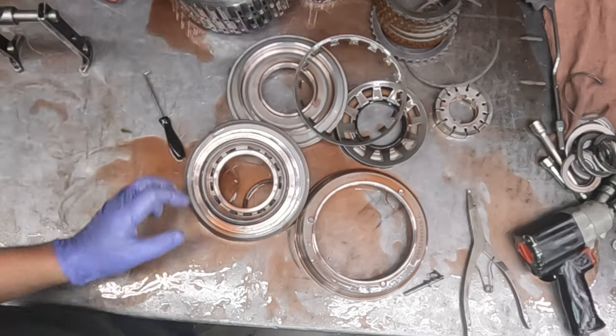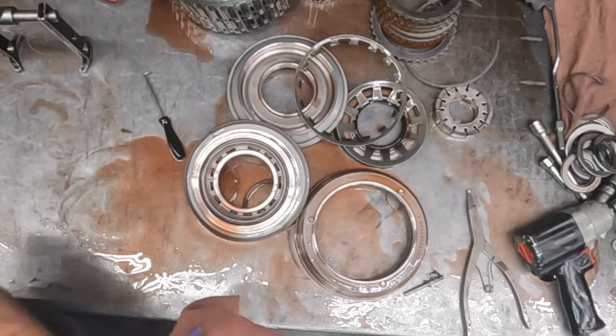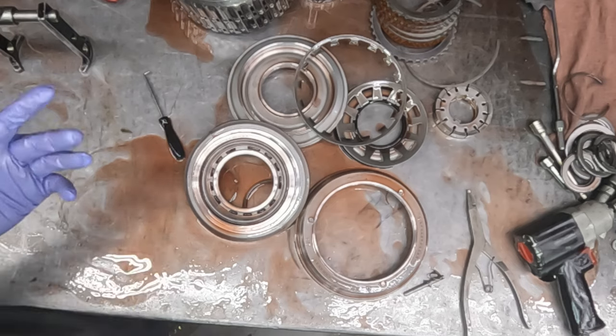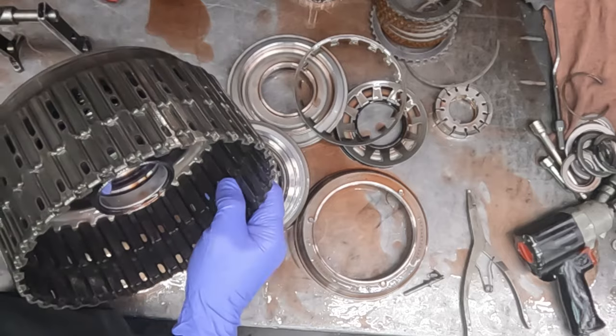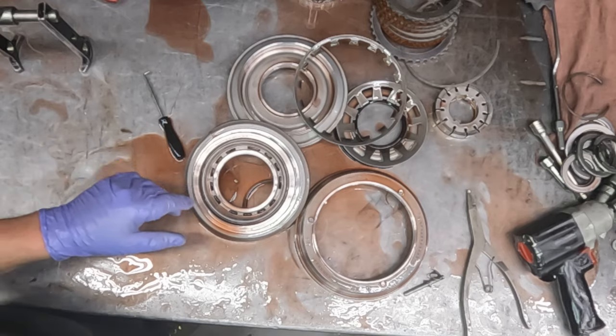Because if you don't, you're going to end up with metallic in the pan, and even though everything's running good, you'll question if everything's really running good, and be like, where's that metal coming from? But it's just washback from crevices like that, and so we want to keep that to a minimum by cleaning everything up really well.